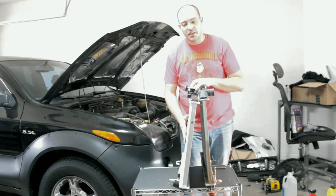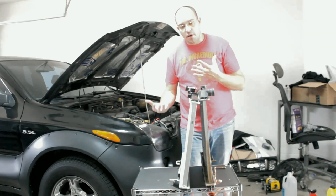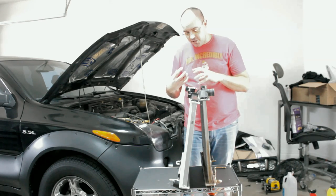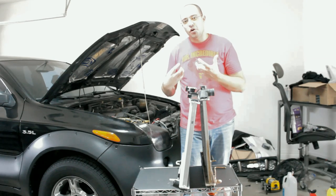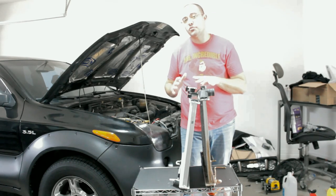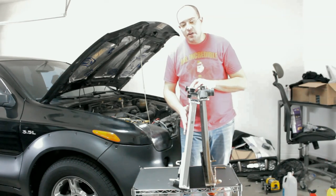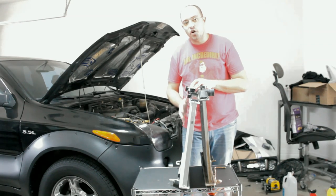This is an aluminum-plastic radiator. There are some that are all aluminum, which would be slightly better. For the most part, the plastic parts can actually be better if you're not having heat issues, because they don't wear or slowly oxidize. A pure aluminum radiator would be great, but most are aluminum-copper or aluminum-steel, and you can get rust on them. The plastic one isn't going to develop rust and is going to be a long-life, low-maintenance part.